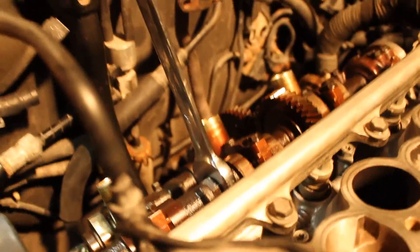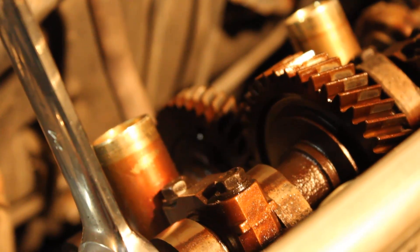At first you do line the dots up on the cam gear, because the only reason the dots are there is you're just putting the cams in sync, so that the exhaust and the intake aren't going at the same time.